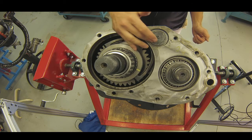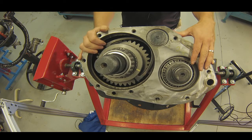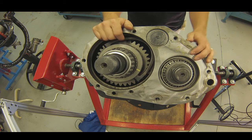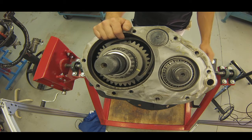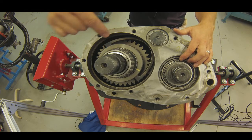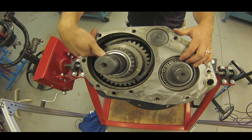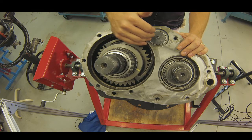This one doesn't come apart easily right now — I need to make some modifications — so I can't go much further on the top side. I wanted to show this integral style because we didn't talk about an integral pinion mount in class yet. We mentioned it because it's in the service book, but you hadn't seen one. I'll make another video where we can actually see the operation of the interaxle differential, but I really wanted to focus on the integral pinion with this unit.